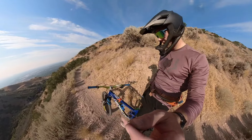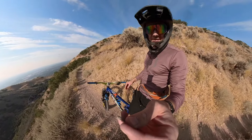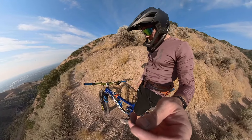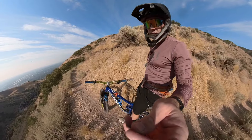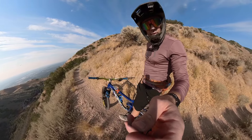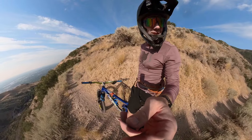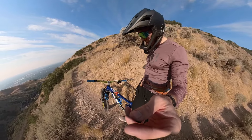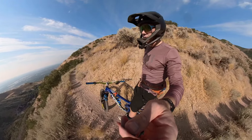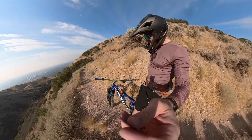Quick rundown on what I've done to this bike so far. The front hub had a ton of play in it when I first got it. After my first ride I took the bolts off, found that the ball bearings were all in the wrong spot, so I packed it full of grease, got all those reset correctly, and tightened it down — front end's nice and tight now. Didn't do any service to the suspension, just tuned it properly, and that made it feel way better after the first ride. I set up the tires tubeless — there was a hole in the rear tire so I had to put a bacon strip in, but I'm still more confident in tubeless with the plug versus having tubes in it, because I did flat the front after my first ride. I swapped out the 125mm dropper for 150mm, and also swapped out the saddle for a skinny road saddle that's more out of the way, because 150mm drop still isn't that much.